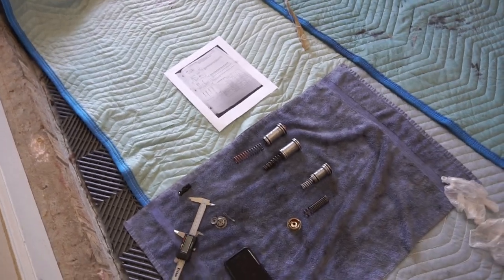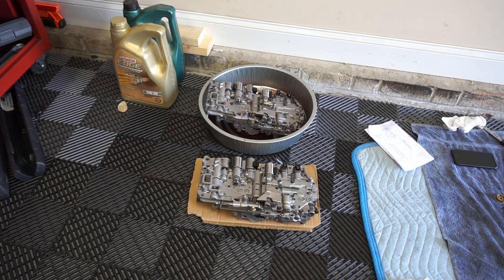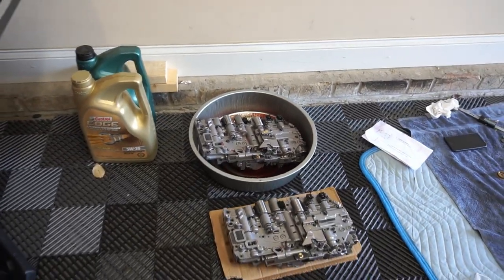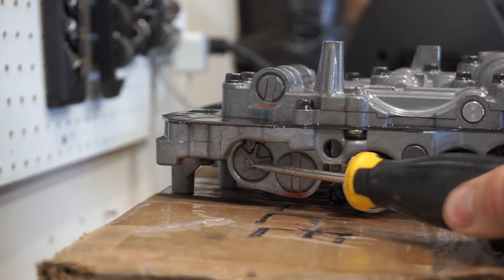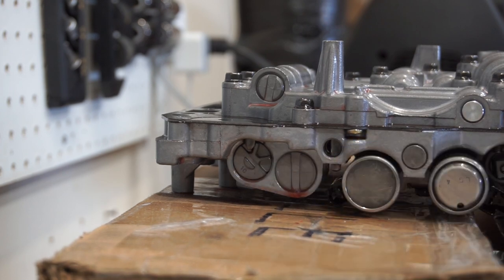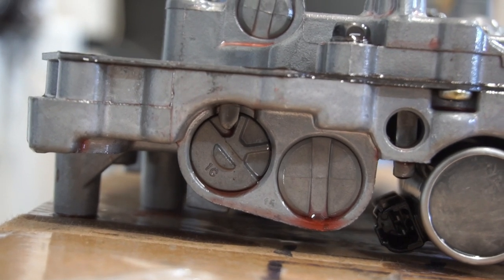This job is very tedious. I don't recommend it for those of you who may not have a lot of experience around cars — I recommend having it done. A trans shop should have no problem whatsoever just dropping your valve body down, and it would be even better if you brought them the modified valve body; they could go ahead and just throw it right in. The line pressure adjustment is on the driver's side. This is the dial adjuster right here, and it increases or decreases the line pressure depending on which way you go. You want it in the position shown — push that in and turn it clockwise to that third position. That will increase your line pressure.